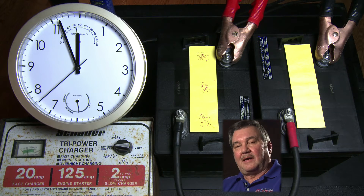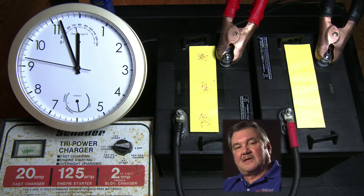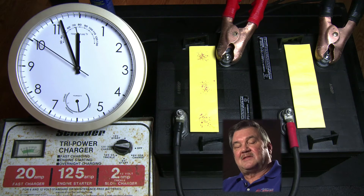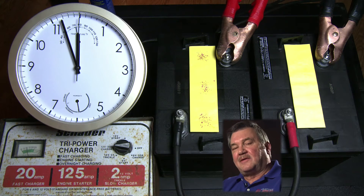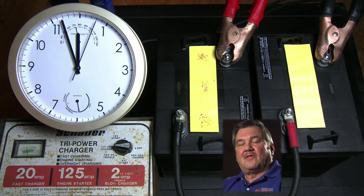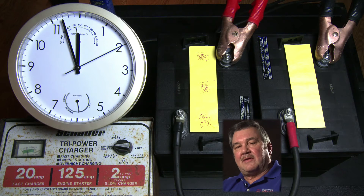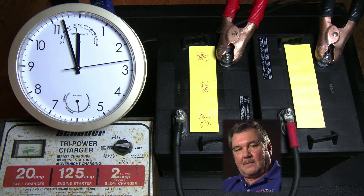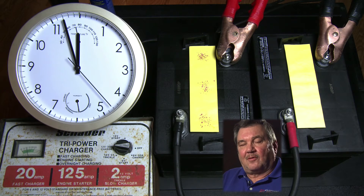And then guess what? You have to buy another battery. Think of it this way: if you bought a new car with a six-cylinder motor and did a compression test on each cylinder, you would want all cylinders having the same compression. If you had one weak cylinder, then five cylinders are trying to do the work of six, and that engine would not last nearly as long as one where all six cylinders have the same compression. A battery is similar — if you have a weak cell, the other cells have to work harder, which greatly shortens that battery's life. So before you treat any battery with Battery Demister, check to make sure all cells are equal. This basically eliminates your chance of losing your warranty, because you've verified that all cells were equal before treating it.